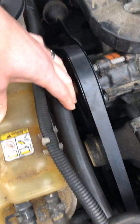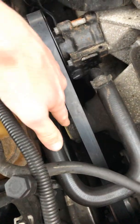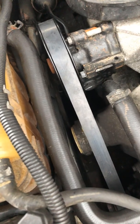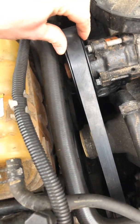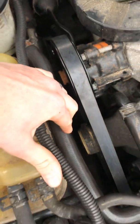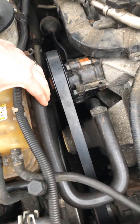There's actually one more pulley you can't see right under where the tensioner is, so there are five total, I believe. After wrapping around those four, I pulled up — my friend pulled up — and it came to about this bolt right here on the power steering pump. I could not pull it up any higher, and that's where you put your bar down in the tensioner, pull to the right, give it some slack — just enough to pull it up and put it on this pulley. Then make sure it is on, and double and triple check that it's on all your pulleys correctly before you start your car, because you don't want it to fall off or snap and make you have to do it all over again.